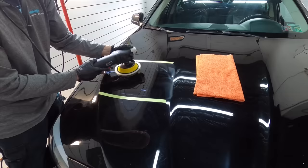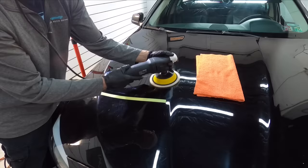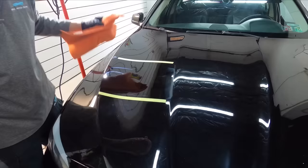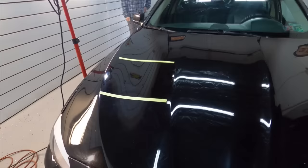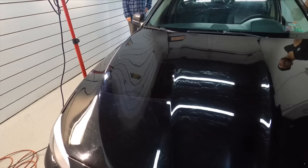You can work the LVR 305 for as long as you need — it has a nice impressive cycle time. Dusting when using the rotary is noticeable but very little. Using a rotary and a wool pad, the wool fibers clean themselves as the polisher is spinning, so you will always have a little bit more dirt to contend with using a rotary. But it cuts so fast and I love to use it. Removing the masking tape — you can already see the difference, and this is just the cutting portion.